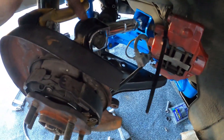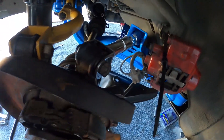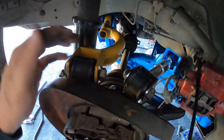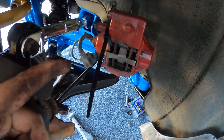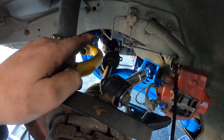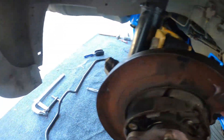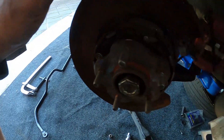Same again on the other side — this side was actually a lot easier. You've got to bend the arms out of the way a bit but easy enough. Rear track arms in, rear camber arms in; just got to do the bolts up. I've got new brake pads for the back because I had the rotors machined — they're ready to go. I've also got to put the CV in and remove the tailshaft bolts so I can spin them around. This should all take about an hour, and it's been time well spent.